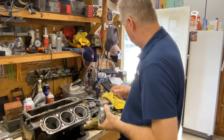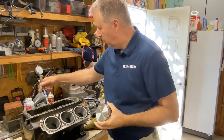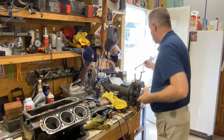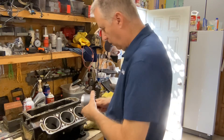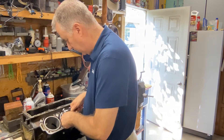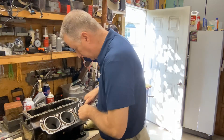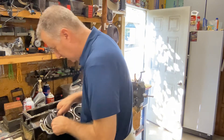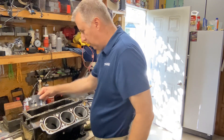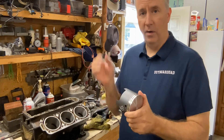This one was right at zero, maybe a hair over. And this one was at just about 2 thousandths smaller, so this may not fit in here at all. Now the top goes in, but it doesn't go as far as the other one. So now I know my measurements are accurate — it's a double check. These were even smaller; again the top goes in, but that's it. So we're really close to where we need to be. It doesn't even go in the top there very much, nor that one. So now we know we're pretty close to where we need to be with our measuring, and we can start honing to get closer to that piston size.